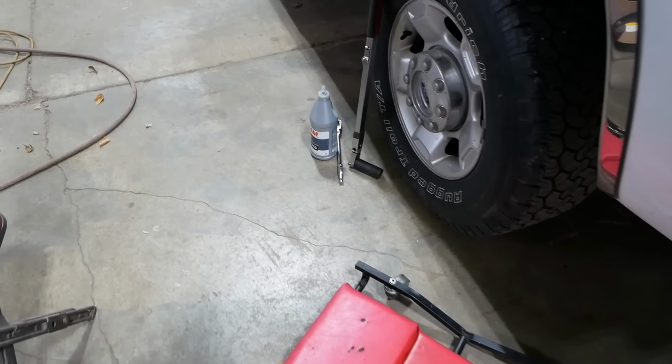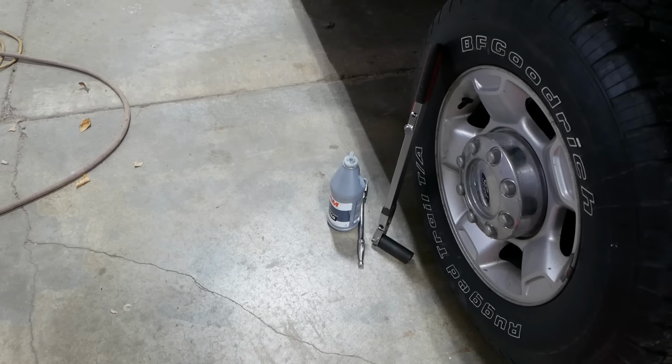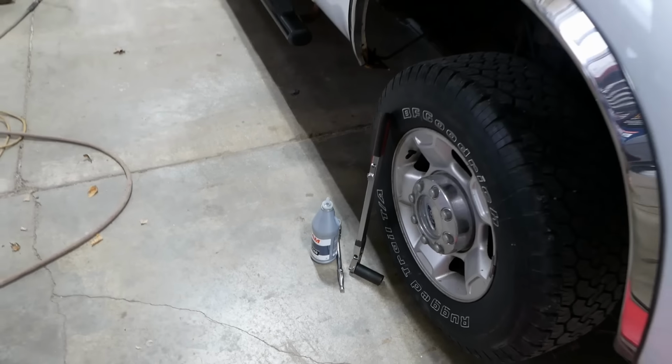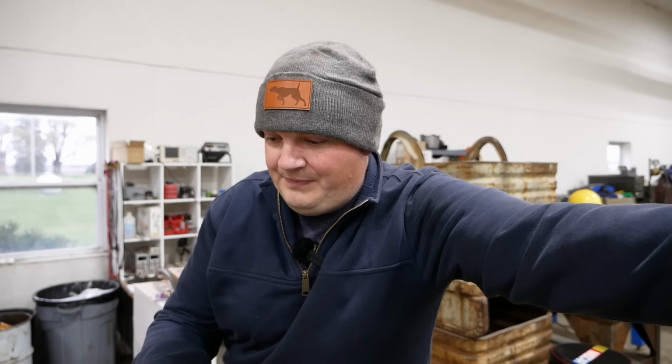All right, folks. I tightened the U-bolts to the factory spec, 195 foot-pounds. I topped off the fluid. I don't see any leaks or anything weird. I think it's time to set this one free. Pretty straightforward, nuts and bolts kind of job. It's a fair amount of work, though, to replace an entire axle. I couldn't find a book time, but I've probably got 6+ hours into this.